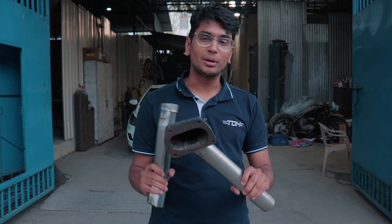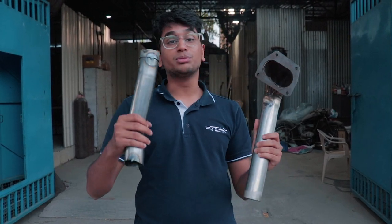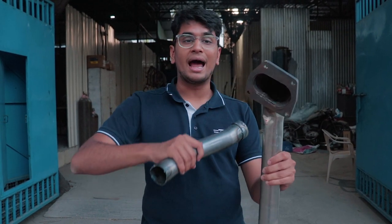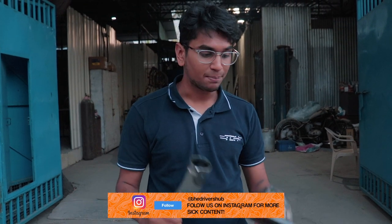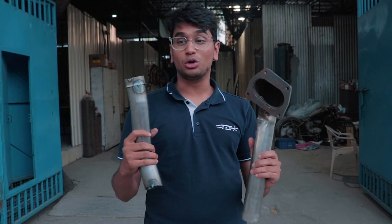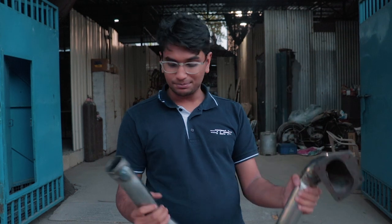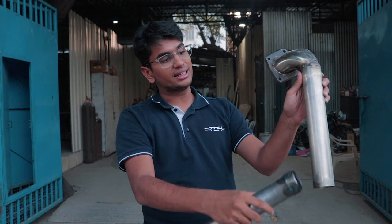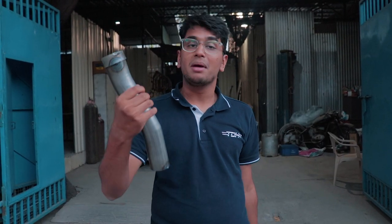It's been almost 10 hours at IES Performance and Tanay's Abarth downpipe has been one of the most complicated they've ever made. This is the original downpipe design made here at IES Performance, built using the jig. However, the team found a better and more efficient way to make the downpipe, making the original jig obsolete. The new design eliminates the need for those indents, which take a lot of time and actually restrict performance. The new design is straighter, while the old one had more curves and angles — the new approach tackles the indent problem while also improving performance.